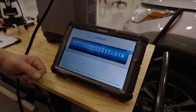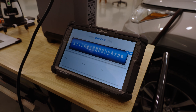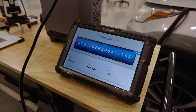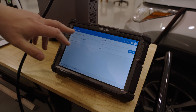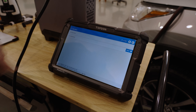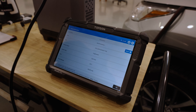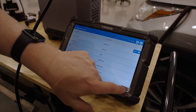We're on auto VIN, so it will automatically ID the vehicle. Anytime you do an automatic identification it may ask additional questions — here it's asking the brand, and it is a 2017 Highlander, which is obviously a Toyota. We select 16-pin DLC for North America and smart key, as this one does not have a physical blade key. It is equipped with radar cruise, so we confirm that and record the basic information.